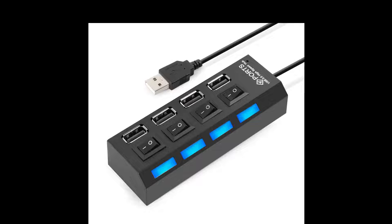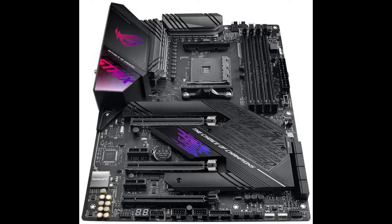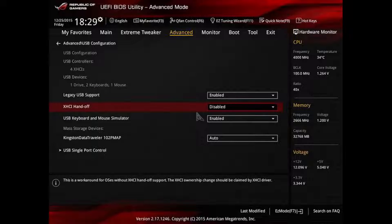Especially complex game devices such as the Thrustmaster HOTAS. If this still doesn't fix the problem, you might have to look at a low-cost hub that plugs directly into your motherboard PCI slot. On AMD systems using AM4 sockets, the number of available endpoints has been increased to a total of 254 endpoints per USB controller. This is the reason it hasn't happened for me since moving to my new gaming PC, which uses a Ryzen 3900X on an X570 motherboard.